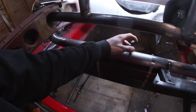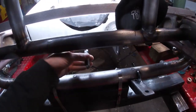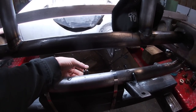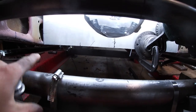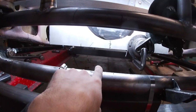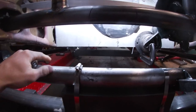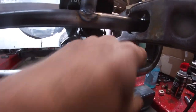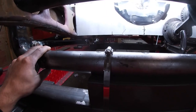We got to go and fit these guys on here. I ordered them wrong, but I think I found something that matches our radius on our front axle. I'm going to mount our rod end up here in the center of the axle, probably angled down a little bit. The wishbone is a Y-type thing — a V point and a point coming off the axle and a non-adjustable point up here. This is a slip joint so it can articulate. This is able to make your axle square with your chassis, and we got it all jigged up so it should be dead on.